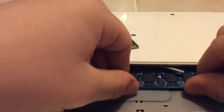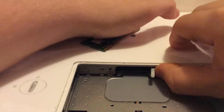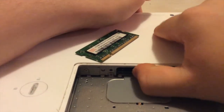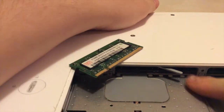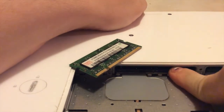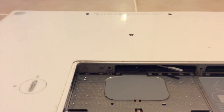Let's replace that with a Hynix one gigabyte module. Let's make sure we put this RAM in the right way and push it in. Now we can put this in our anti-static bag so we don't ruin the RAM. I might try selling this in the future, or I might just save it in case I ever need a 512 megabyte module. Do the same for the other slot.